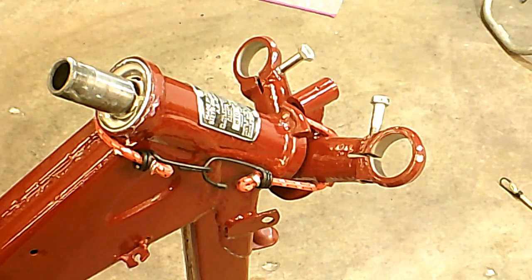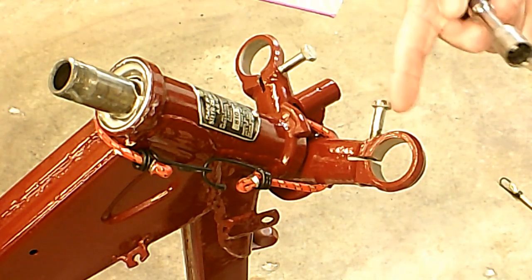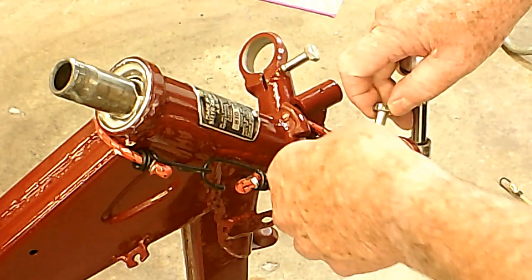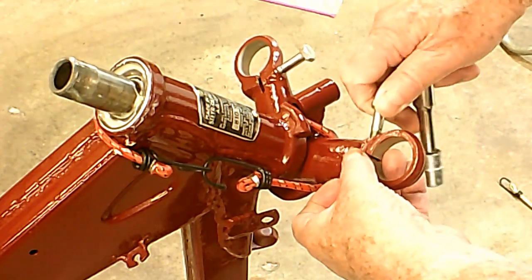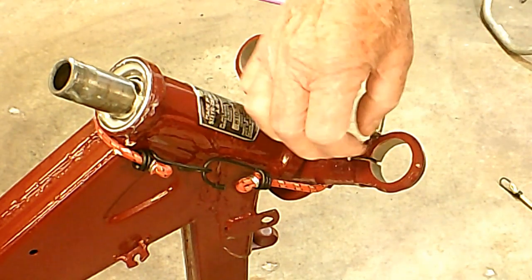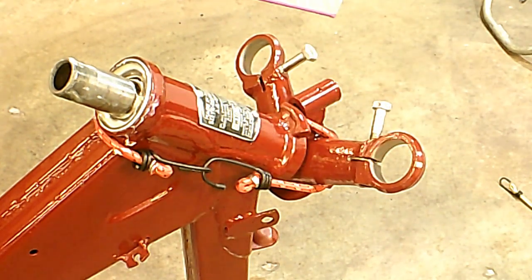While I go to take it out of there, you can see both of these — I want to put it in this slot, and I put the clamping screw in from the other direction. It's supposed to go this way and I put it in from the front so that it will give me something that I can push against in there. The idea being it's going to ruin the pinning, but when I tighten this up it's going to spread that crack just a little bit so it makes it easier to get the tube to slide in there. At least that's the idea of it.